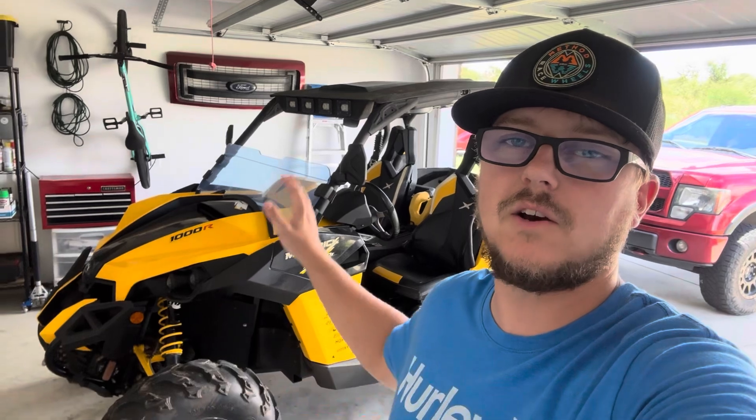Welcome back to the channel. This video is going to be another preventative maintenance video on my Can-Am Maverick. I plan on trying to hit all the grease fittings that I can find and grease them up, and this also gives me a chance to look at my drive shafts. The rear one has a grease fitting on it, but I'm going to be checking the u-joints to see if there's any play. If there is, in a different video I'll probably replace the whole drive shafts. There's a skid plate on the bottom — if it's riveted I'll hold off, but it looks bolted so I can get to the rear drive shaft easier. Let me get to setting up my grease gun.